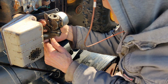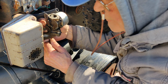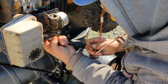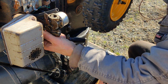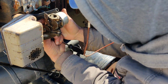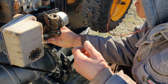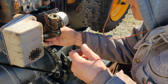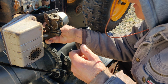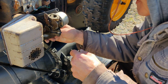If you just stick your 2 fingers up here, you can grab hold of the nut. You can unscrew the nut. And then you can just pull your bolt out. Might have to loosen the other side here to get the bolt out. I just don't want the bolt to fall into Never Never Land over here. I should have loosened this one too first, but we didn't.